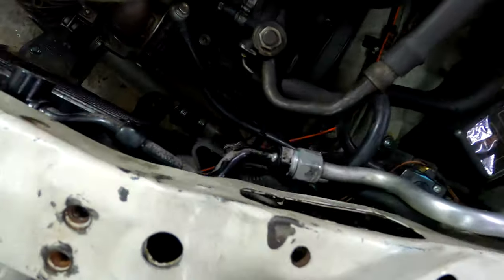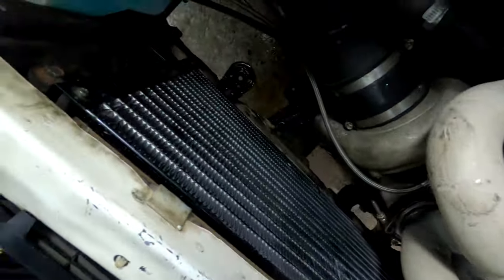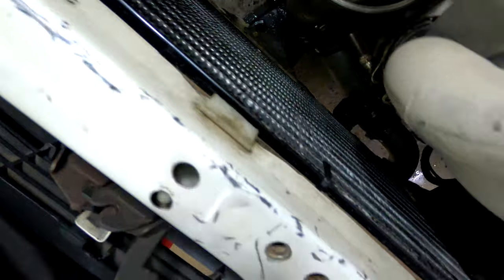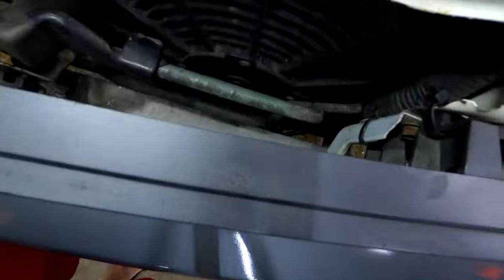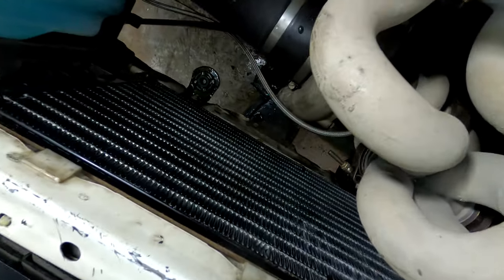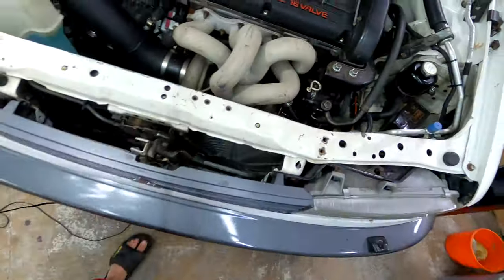All right, we are in. It was a tight fit, and I swear something in here is just bent very minimally, probably from all the torque. I wouldn't doubt it, but had to just make sure everything was a good fit. Had to bend a little bit of lines just to make sure everything was in place. Got the fan in again, and then we are bolted on both sides. So stick the radiator in and pull a vacuum, and then we're done with this part at least.